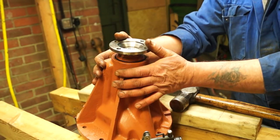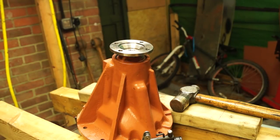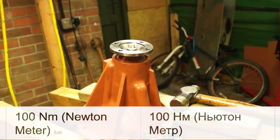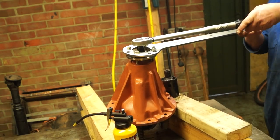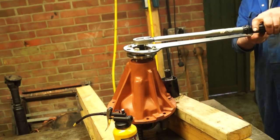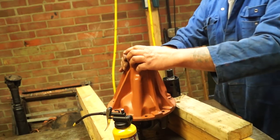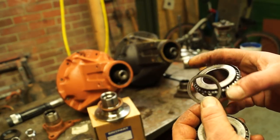Once that's right, the flange just goes into place. You have a washer retained from the kit and a bolt which has thread lock on it — important to have the thread lock on there. Torque this up to 100 Newton meters using a flange holder and a torque wrench set to 100 Newton meters with a 15mm socket. Click it off and you're done. Check that the flange will turn fairly freely — it should have 4 to 6 Newton meters of resistance. If it's locked up solid, you've probably lost the shim or put it in the wrong way.